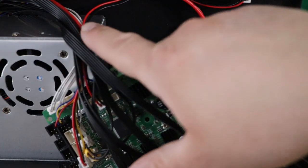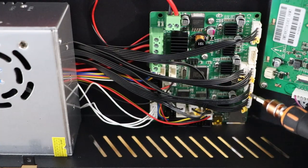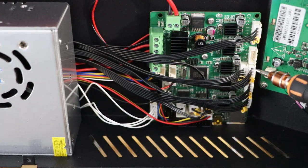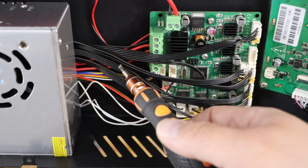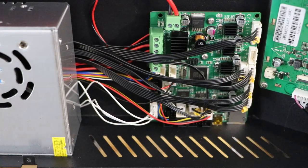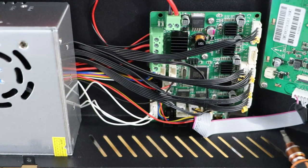I clipped the zip tie to release all the cables to make it easier — we can put a new one on later. The new board is in, everything is in and tightened, and we checked all connections for good tight fits. When taking off connections, they do hot glue them on the old board, so make sure you pick that hot glue off before pulling the connections. I didn't re-zip-tie the wires — I'd rather have a little slack. The last thing is to push in the display cable and tuck it down. Now we'll put the bottom panel back on and flip the printer over.